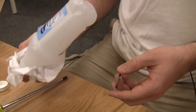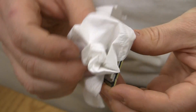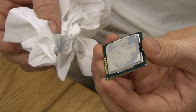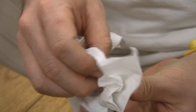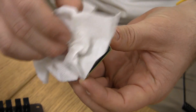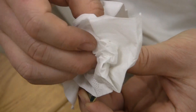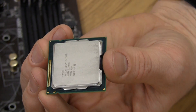Now it's time to remove some thermal paste or thermal compound. Apply some rubbing alcohol to your cloth or q-tip and brace the CPU. You'll want to rub with the grain of the metal, preferably, to make things easier and ensure that no thermal paste is left in the crevices. Continue removing the compound until the surface is shiny and clean. You should see the alcohol evaporating away momentarily, so set the CPU aside after you have thoroughly removed all of the thermal paste and let it dry out before reapplying — that way no rubbing alcohol gets stuck in the system.